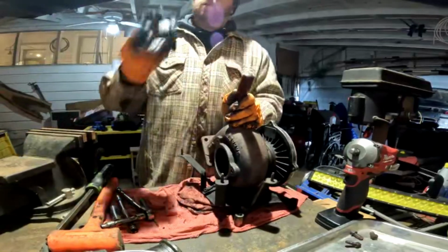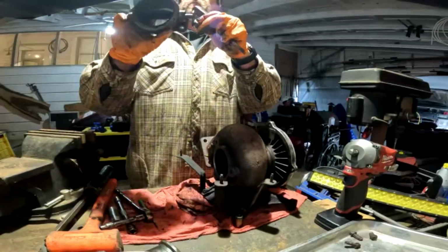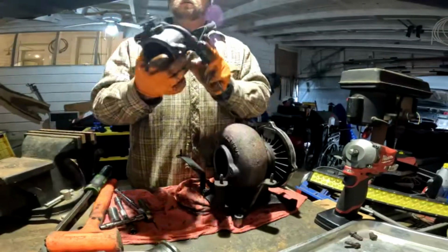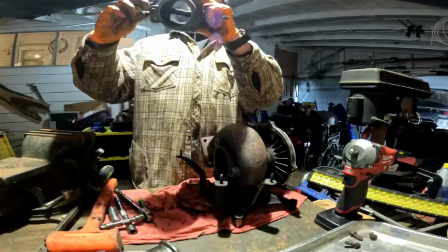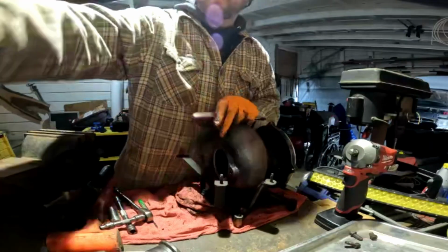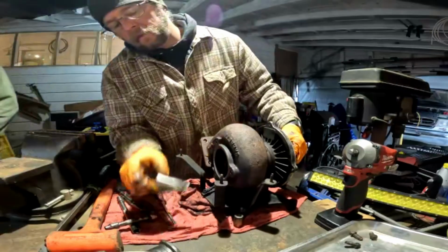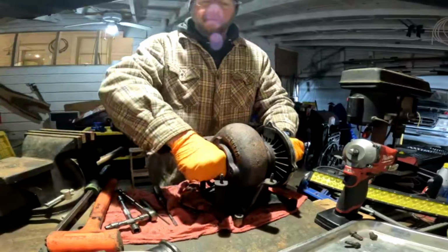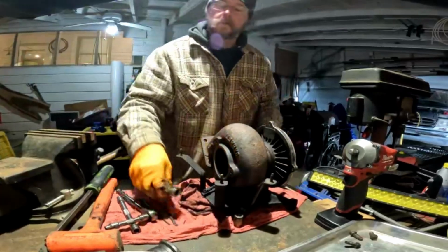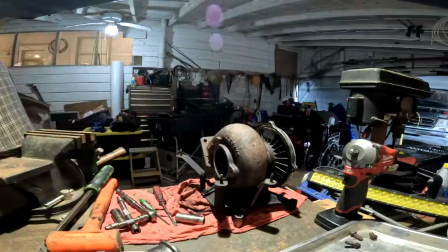Try to be gentle, but that will no longer be going on. We are using a high flow housing that eliminates this butterfly. That butterfly is your exhaust back pressure, closes to apply more back pressure, therefore heating the engine faster. So that guy, this is a dirty job.